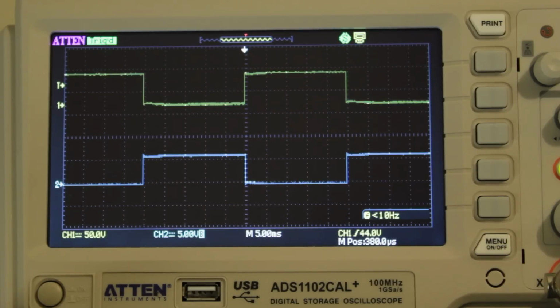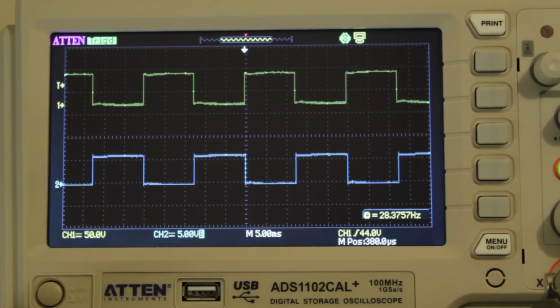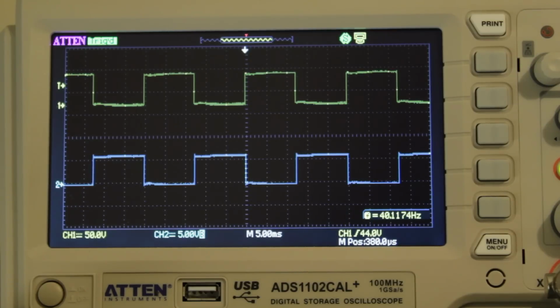Now if we tried the same thing on the UK speedo, you would hope that you'd see something different on the speedo output towards the ECU. If there is something that removes the speed limiter, I'd either expect to see the signal being modified in some way, or indeed even just the frequency changing, so that it would be, say, a multiplier or something along those lines. Perhaps it's even just a steady pulse train that's generated to trick the ECU into thinking that something is there or the car is moving at a particular speed. Either way, we'll try it and see what happens.